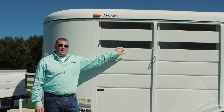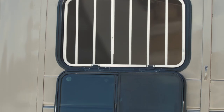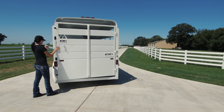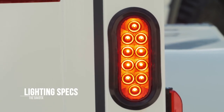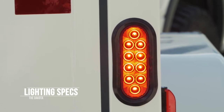The Dakota features open stock sides. However, you have the option of adding plexiglass into the inserts on both sides or on the rear gate. Another popular option is the addition of drop-down feed doors, which are normally installed on the head wall. At the back of the Dakota is a single piece full swing rear door, which is attached with three heavy-duty greasable hinges. The Dakota features sealed LED lighting with the tail lights being recessed and grommet mounted. An LED license plate light is also included, and all lighting on the Dakota is DOT approved.